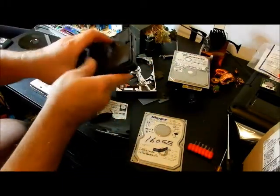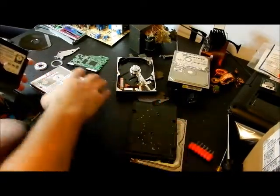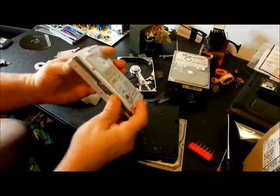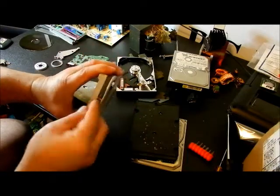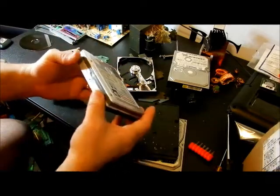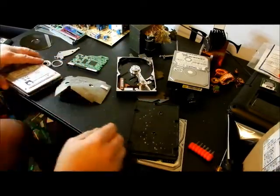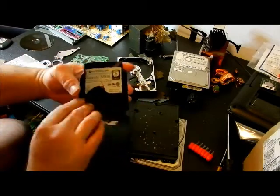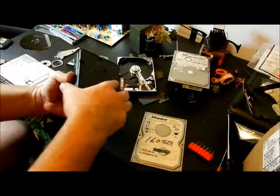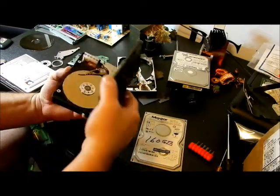This other one — I had a little experience with this guy. This is a Western Digital and they have this little band — 'warranty void if removed' — going around it. What you have to do is take a screwdriver, get underneath this piece right here, and peel it all the way around. It's like taking off the plastic band on milk jugs to get the lid off. Once you get the lid off, this was crazy because we took this whole plate off — we pried this up looking for other screws. This is the drive right here, and you have to stick a screwdriver in there to pry it apart and it comes apart like this.